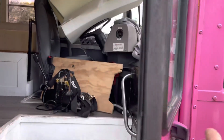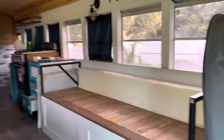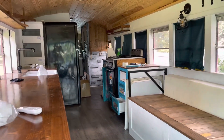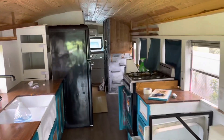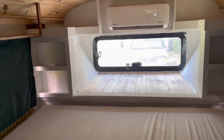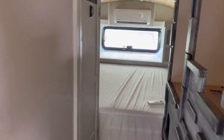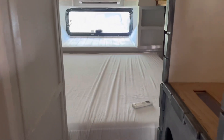I recommend having a 12k up front like this, since this is where most of the windows are and the common area. In the rear you want to have a 9k — that makes it very efficient, and generally that's when you're sleeping. You've got this small area back here that's basically for sleeping; you can cool it much easier by having a curtain or something closing off the front to make it a bit more efficient and save some power.